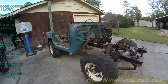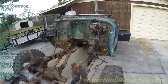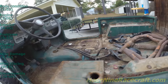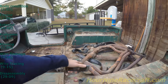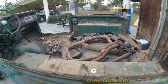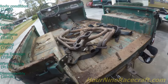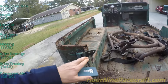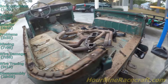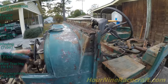After getting the body panels, engine, transmission, transfer case, and all that stuff pulled out — we broke a lot of bolts pulling off the fenders, whether we were heating them or using PB Blaster. We had to cut the headers off because the exhaust pipe wasn't letting us unbolt it and it had been patched there anyway. These aren't stock — we're going to try to find the stock exhaust manifold and get rid of those headers; they're rusted through anyway. The back door screws — we managed to heat them up and hammer a P3 Phillips bit onto them and crack them loose. We broke off one and another had the inside stripped out — we put vice grips on that.